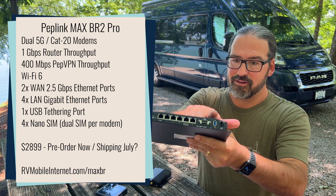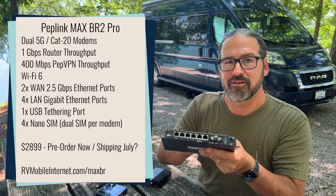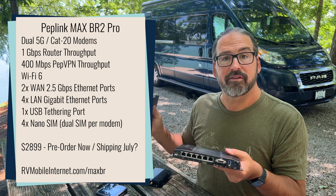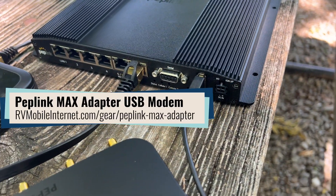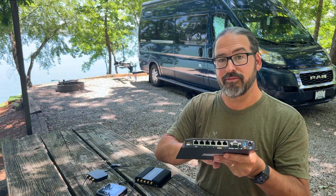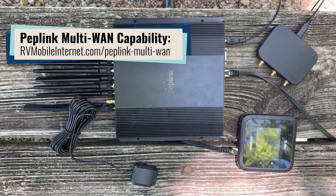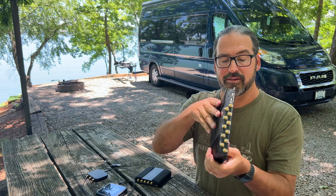Something very exciting that has been a long-time wish: Peplink is finally putting a USB port onto the Max series. For the first time on the Max, you can tether via USB to mobile hotspots or things like Peplink's Max Adapter — just plug in that USB and you've got another connection. That brings us up to five connections. The Wi-Fi radio is also capable of Wi-Fi as WAN on both 2.4 GHz and 5 GHz, bringing the total up to seven potential connections via load balancing or SpeedFusion Cloud bonding.